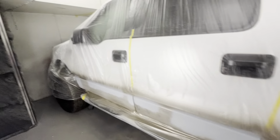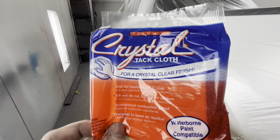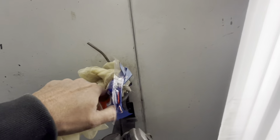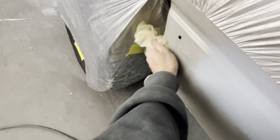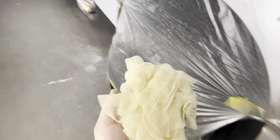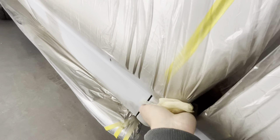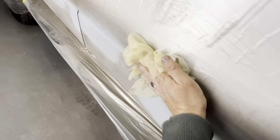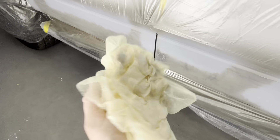We're going to take our air blower, blow this thing down, wipe it with our hands to get the dust off, then use a tack rag and tack everything down to get it clean. We're also going to blow all the dust off the plastic. I have the booth on so everything goes to the filters at the front of the booth — hopefully this can be as clean as possible without starting all the way over. We're wiping everything down with a tack rag — ball it up so it's loose and just wipe everything down to pick up any last bit of dust.